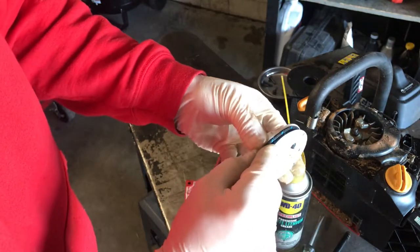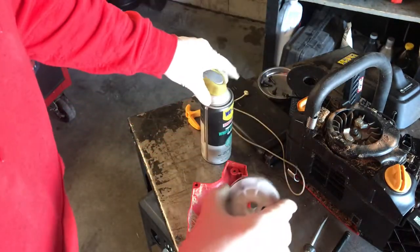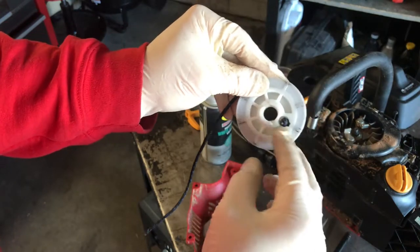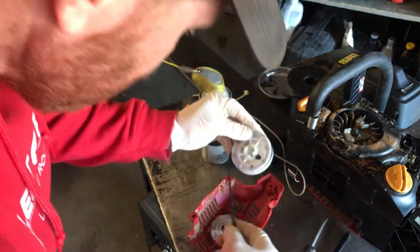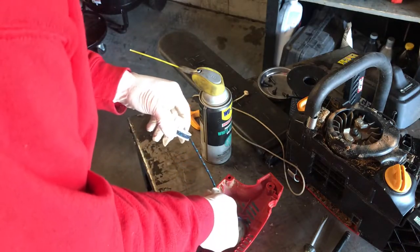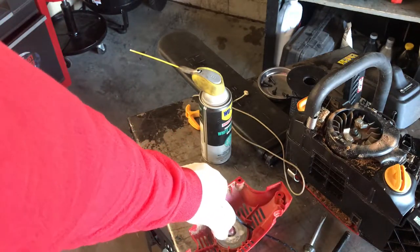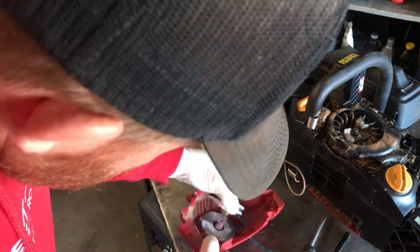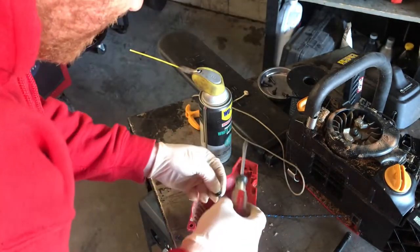You want to just leave a little bit extra so you wrap it around. You don't want it sticking up above the plastic. And then again in the bottom here are these grooves, and the grooves have got to fit into the spring. Then you also got to take the line and feed it out the housing — feed it out the housing — and look where the spring is at, look where your piece is at, and set it on there. You just kind of move it until it drops in, and you just take your screw and washer and put it back in.